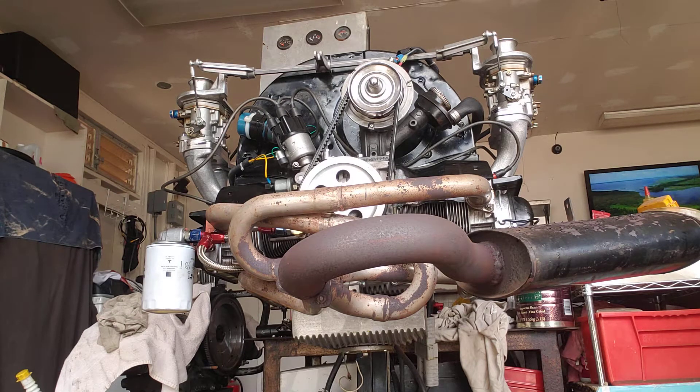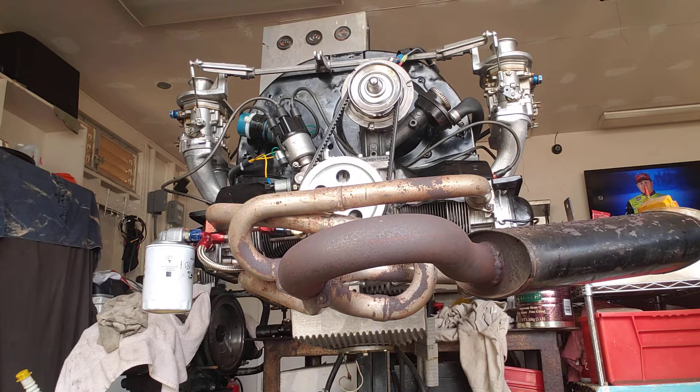The cam I used is an FK44 cam. The effective lift that we got is 563 at 290. The lifters are SCAT SLR coated from Steve Long. The rockers are SCAT Pro Comp 1.4s that are specking more closer to 1.46.